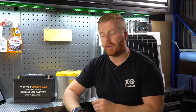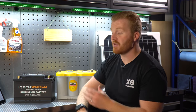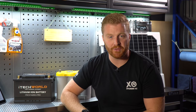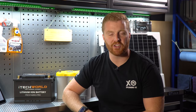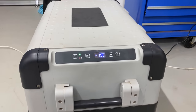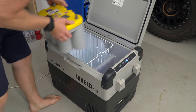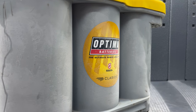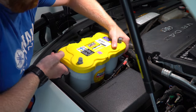The next test is similar to the one we've just completed, however this time we are going to freeze these batteries. Keep in mind that cold cranking amp ratings given to starter batteries are measured at 0 degrees Fahrenheit, which is equivalent to minus 17.8 degrees Celsius. We're going to place both batteries into freezers at minus 20 degrees Celsius, then place one at a time into the vehicle and do the cranking test again — three cycles of 10 seconds and the fourth time starting the engine — to see what effect it has on minimum voltage when trying to start the big V8.